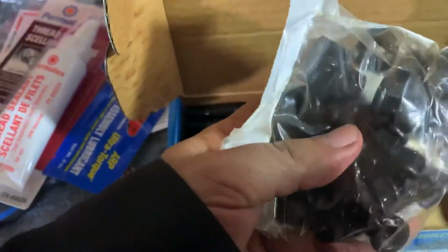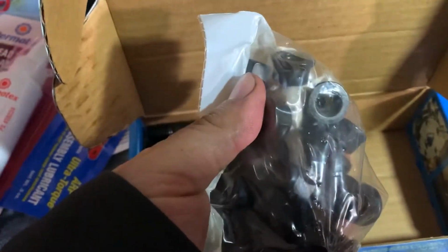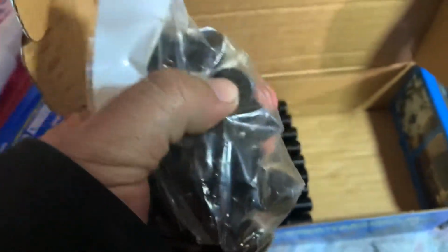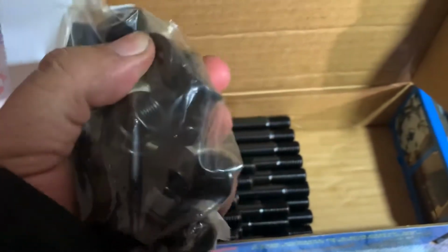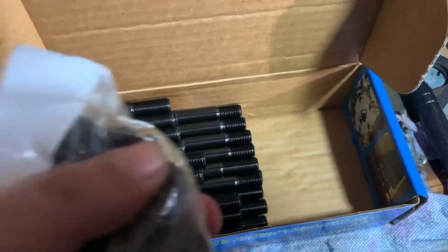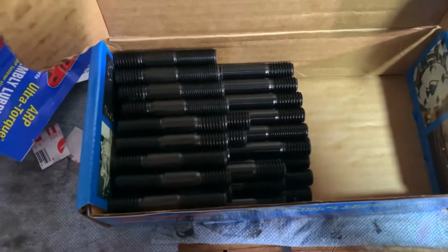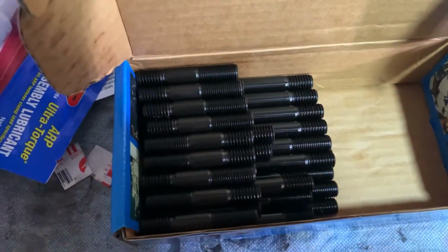And then the nuts. The reason you gotta lube it, because between the flat of the nut and the washer, that binds, if it grabs a hold, you'll get incorrect torque readings. So they want you to lube. That's what they want you to lube. So you get correct torque readings. So it turns freely. There's no binding against the washer.